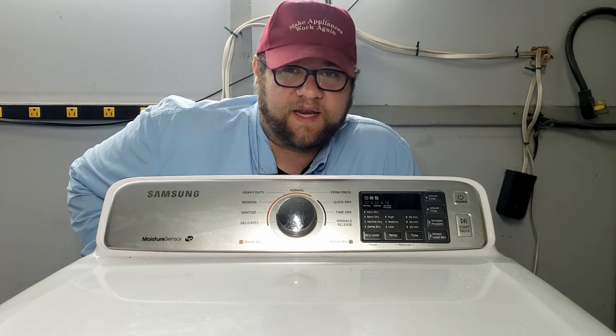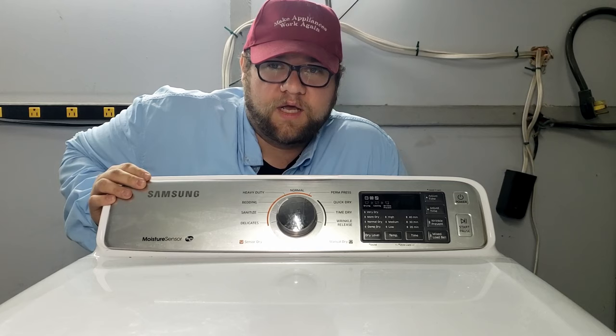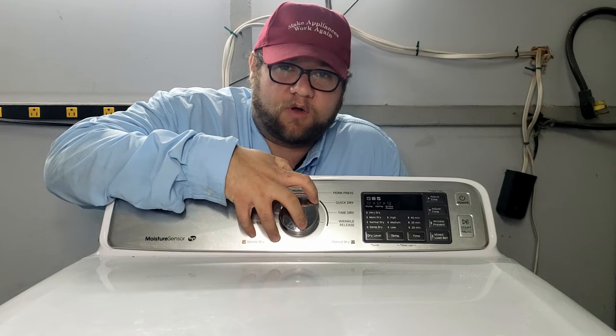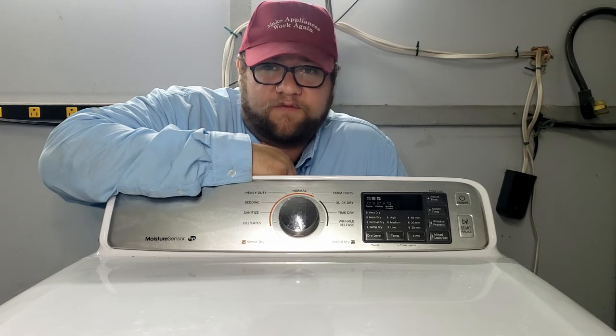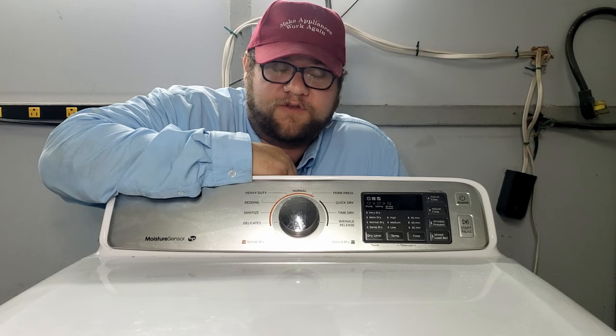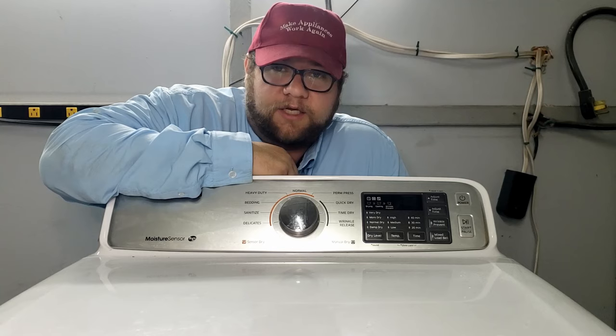If you've gone through all of this and you're still not finding heat on the unit despite replacing every sensor and wiring everything correctly, you've narrowed it down to only a few other things. For this type of dryer or a front-load Samsung, it's either going to be the control board relay — which you can test with a multimeter, but have a tech do it since it requires dealing with live voltage — or it could be the motor and its centrifugal switch, requiring a motor replacement. Possibly also a severed wire — check all connections everywhere in the unit. If that doesn't help, unfortunately you may need a new dryer.